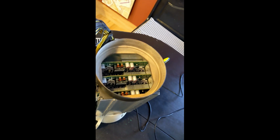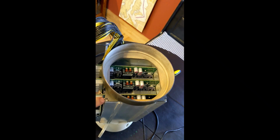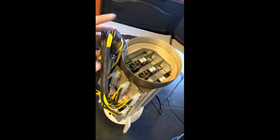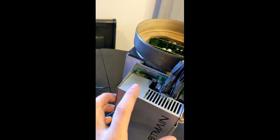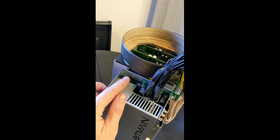And then with the shroud, you just remove all 4 screws, and you actually remove that little metal plate that goes in there as well. You're just gonna use the same stock screws again to mount the flange. As far as mounting the PSU, I have a tiny screw run in here that was one of the screws I had left over. But you gotta be very, very careful with those if you're gonna mount it with screws, because there's not a lot of room. You can easily, if you're not careful, hit those heat fins and cause problems.